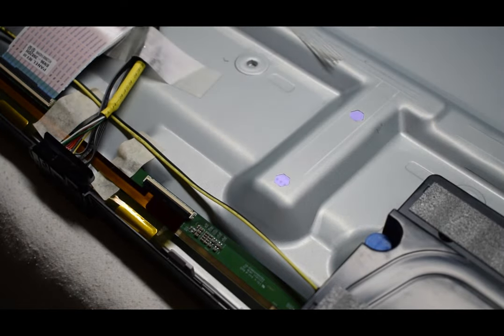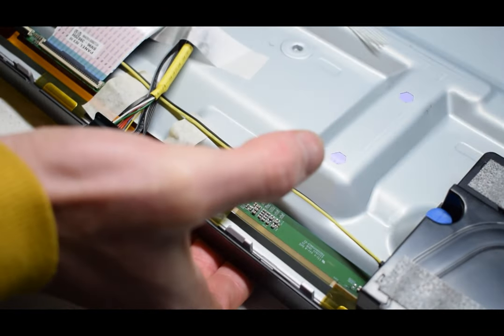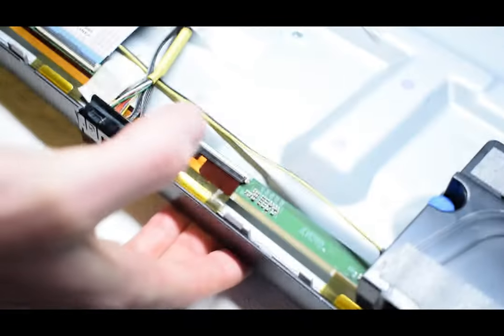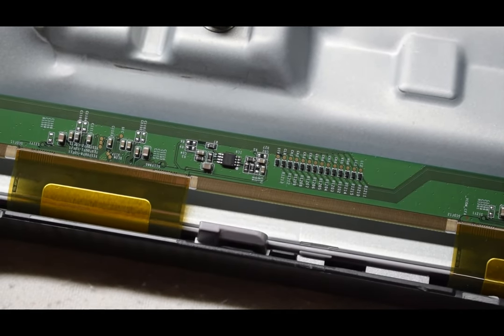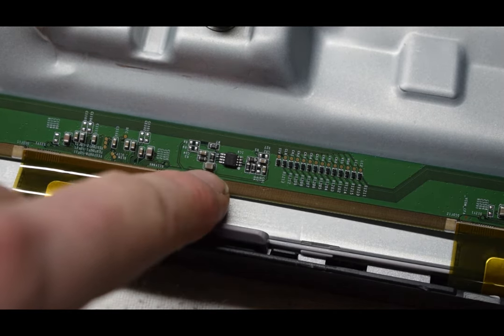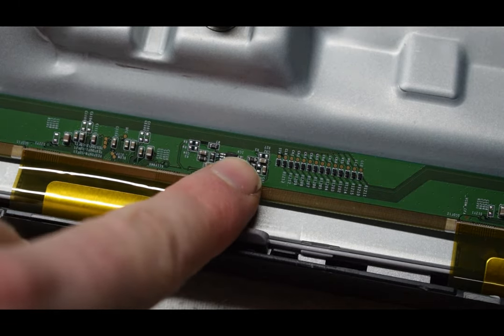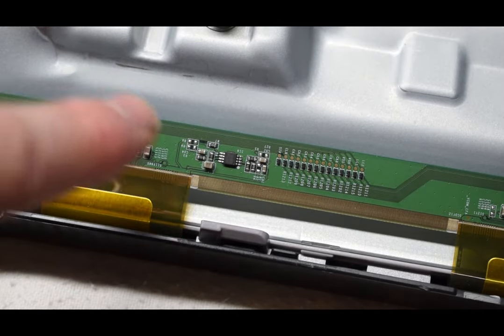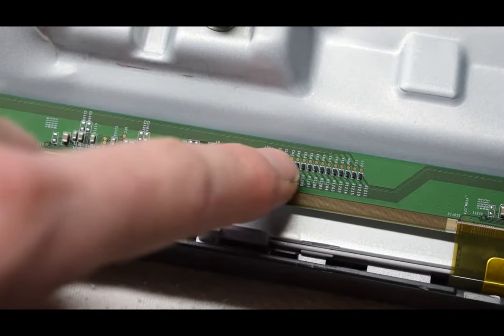Unfortunately, that usually works. But for this one — even though I found the problem — it's not going bright. So there are actually these components. That tape trick only works if you have a bad LCD panel, meaning one of these ribbon cables is bad and you're just disabling that. But it doesn't work if you have a bad capacitor or a little IC chip on the PCB board. In that case, it's probably better to get a new TV. I will try to find the problem — there are all these little capacitors; it could be a bad capacitor. I have never seen that situation before — the tape method has always worked for me.